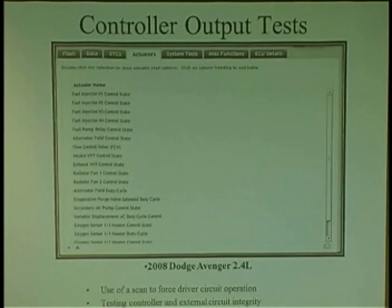He bought a relay aftermarket, and it was an electronic relay. It wasn't a regular standard field coil relay. The field coil relay has 12 volts go through the winding, and then the computer goes 12 volts high, grounded. This sucker had 5 volts. So the computer still grounded it. It came on, but it was 5 volts. It wasn't 12 volts. I'm like, oh my God. This dude sold an electronic relay that didn't belong in the car. It worked, but it was wrong design.